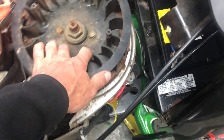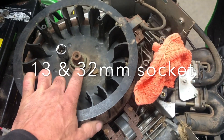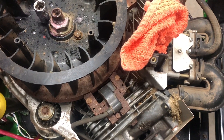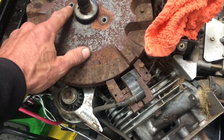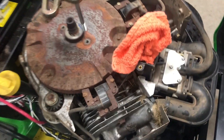Now you've got two bolts here. Next, take the fan off the flywheel — that takes a 13-millimeter socket — and this nut here is a 32-millimeter. I'm gonna spray a little WD-40 on it. It comes right off. Take the washer. These are 5/16 bolts, coarse thread. I bought this cheap puller — I think I only paid five or six bucks for it — and I bought four-inch-long bolts to thread in.